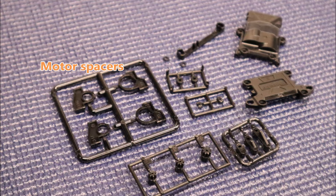There are also shock damper stays of differing lengths. You'll need these when you change your wheelbase. There are also some spare wheel nuts, which you'll surely strip or lose. Same with these C-clips for the front suspension. And two additional 0.8mm shims to adjust the ride height of the front suspension.